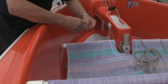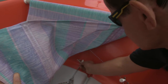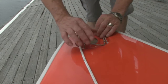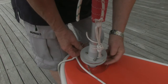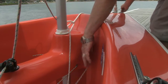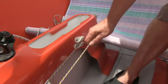In preparation for fitting the final spar, the seat must be lifted to access the shock cord attached to the furling lines. This shock cord keeps the tension in the furling lines and must be slackened before the foremast can be fitted in place. Now that it is not under tension, the jib furling line can be pulled forward and looped. Place the foremast in the hole and bring the furling line up over the lip to sit neatly on the drum, making sure the spar is seated correctly. Test the furling line from inside the boat to ensure it is working and rotating the spar. Fasten the shock cord back in place and replace the seat. Cleat the furling line.